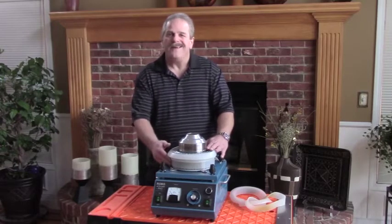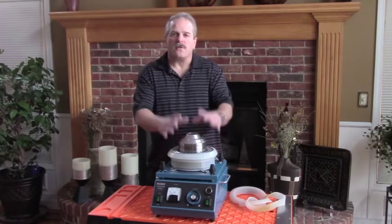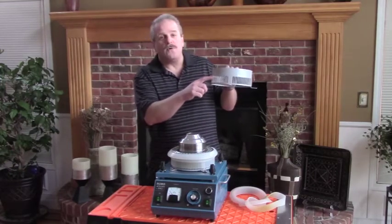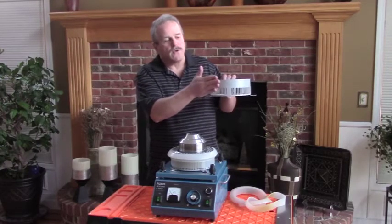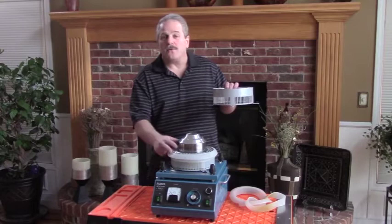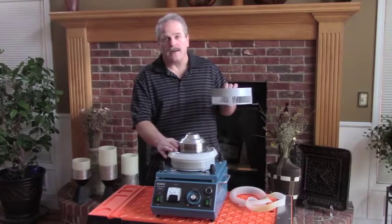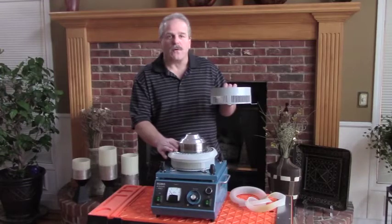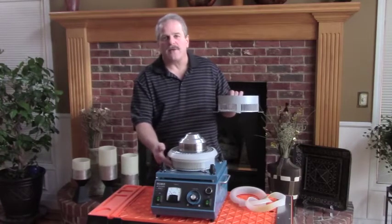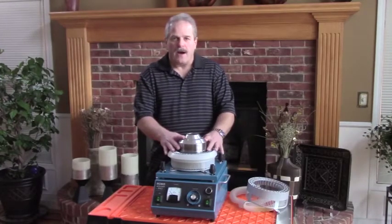However, the airflow restriction ring is designed to do just that, to restrict the amount of airflow making it to the impeller and therefore controlling the amount of updraft produced by the machine. The actual stator itself allows for up to 1 3/8 inches of air intake, and we're using the silicone ring to restrict how much of that register is open. For indoor usage, you want to restrict that down to about 1/4 inch. Much more than that, and you will have such a forceful updraft you won't be able to control or make cotton candy. Outdoor use in high humidity, you can have this more wide open, and we'll cover that in future videos. But for now, fit your silicone ring for indoor usage to about 1/4 inch, and that will be sufficient to start. The next step is to attach the floss pan, and we will do that now.